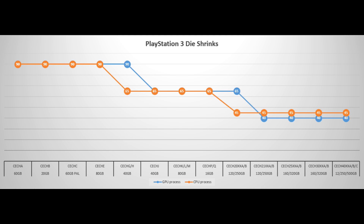I've stated in previous videos that the PlayStation 3 Slim was getting the Yellow Light of Death, and a bunch of people decided it was better and more reliable. I told you: the first generation Slims were more prone to the Yellow Light of Death than subsequent models. It's the CECH-20XX A and B model — the 120 gig or 250 gig Slim. If your PS3 Slim has a 20 in the model number, it is more prone to the Yellow Light of Death, because they kept the GPU at 65 nanometers while bumping the Cell processor down to 45 nanometers. The graphics card still generates the same heat as the 160 gig fat PS3.